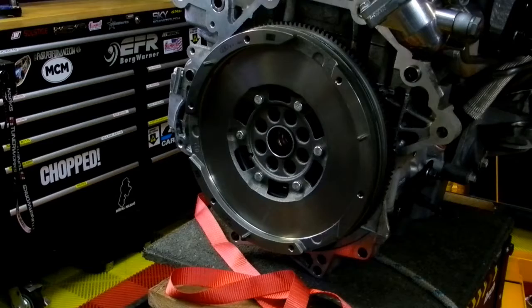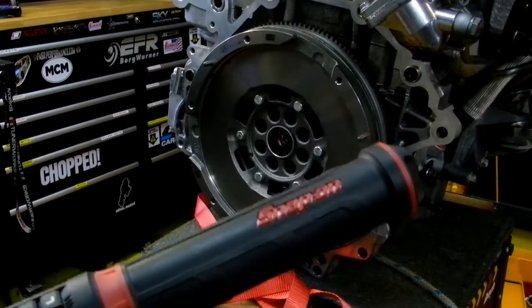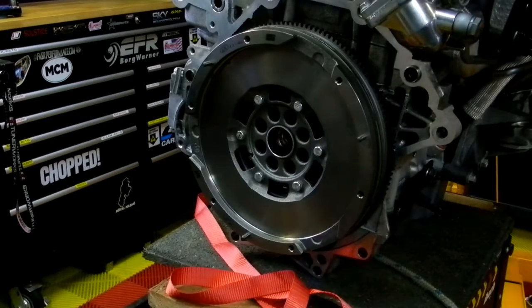So it's nice to have the 3/8 drive as well, the smaller one, and that also does, if I remember correctly, inch pounds all the way down to like 45 inch pounds or something. So pretty accurate. This one does not. It goes as low, I believe, as like 120 inch pounds, so 10 foot-pounds. While I've got the camera rolling here, I just wanted to show you how this guy operates.